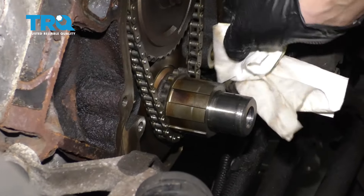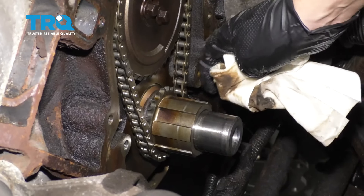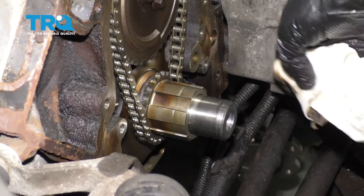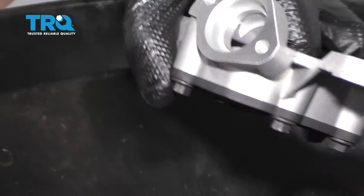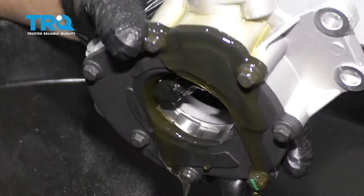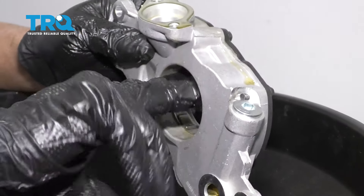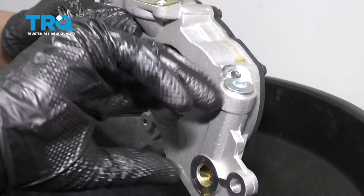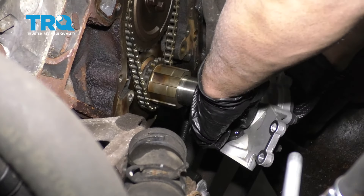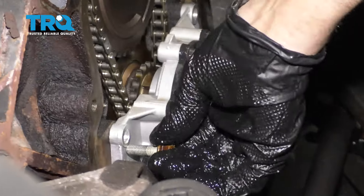Now you want to clean this area — just make sure there's no gasket material on there. There's no gasket that goes there, so just make sure that's smooth. The oil pump will adapt right up to that position there. So just so I don't install this pump dry, I'm gonna take some motor oil and just fill the pump up — this is more of a personal preference just to make sure that it's not dry. There's oil in there and I'm just spinning the pump drive, making sure that it gets lubricated properly. Now I can line the new pump up — that's lined up — and put the bolts back in. Now I'm gonna torque these bolts to 18 foot-pounds.